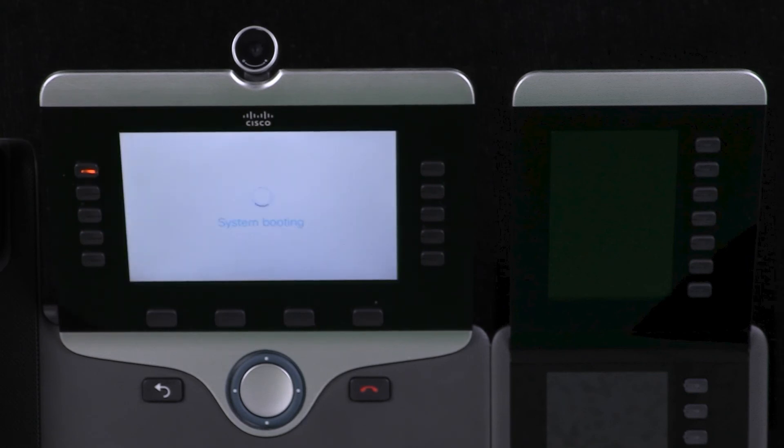The reaction of the phone to different types of tags depends on how significant the tag is to the phone's operation. Sometimes it's a fairly simple change and the phone doesn't go through a large reset — it's near real-time. As an administrator it would probably be safer to do all the tags before delivering the hardware to the user, but if the hardware ends up on the user's desk and they ring you to say it's not working, it's pretty straightforward and near real-time to fix. That's the TIPPIT environment working.